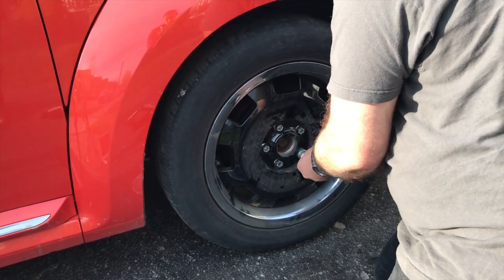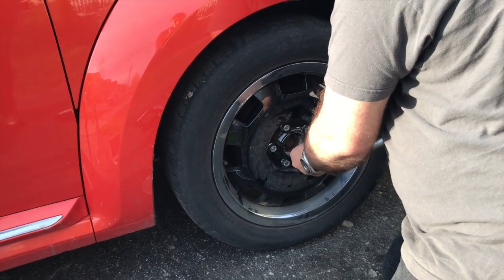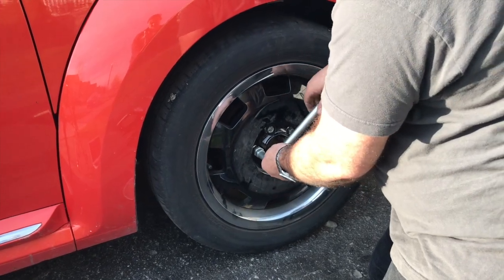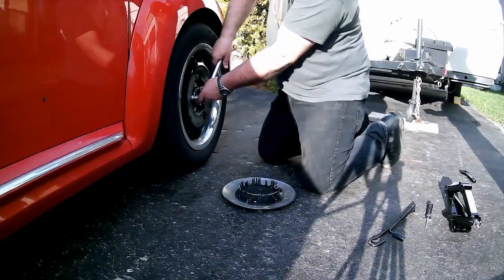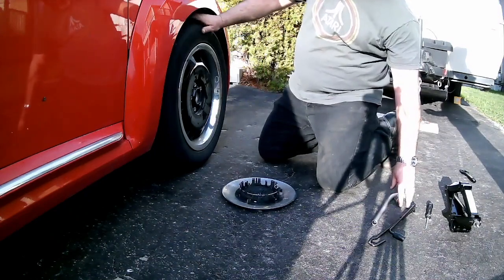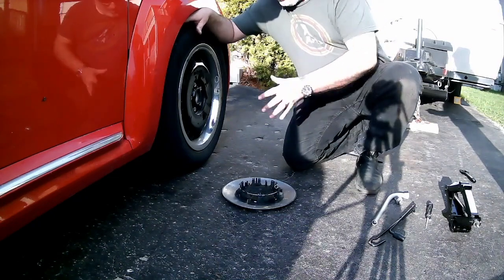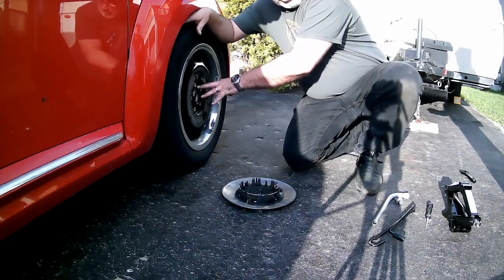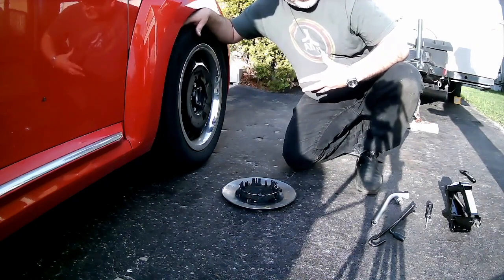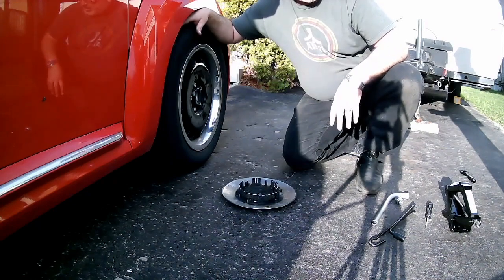I've done all 5. Now the first thing I'm going to do when I get home, or I get my car to a service center, is I'm going to get a torque wrench and I'm going to check them myself, or I'm going to get a mechanic to check them. And then I'm going to drive the car for a couple of days, and then I'm going to repeat that procedure. Because it's really important that these lug bolts are torqued to the correct specification. If they loosen off while you are driving, you might experience wheel loss, which is a life-threatening situation.